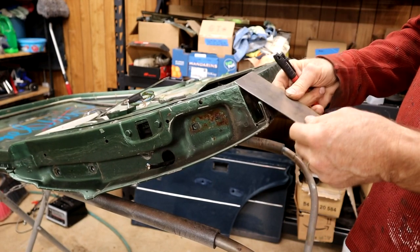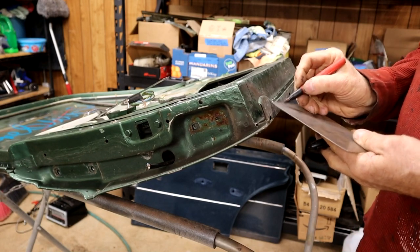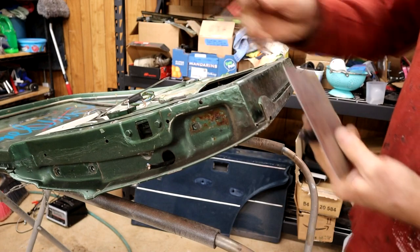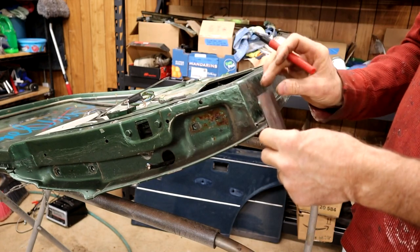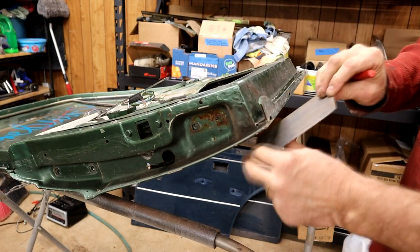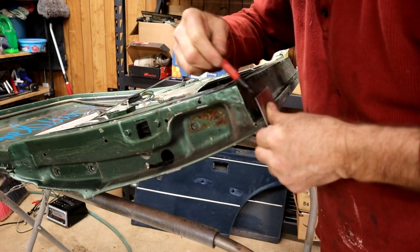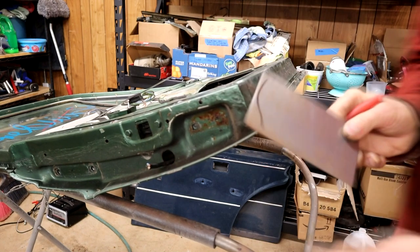So this is going to have a folded lip approximately, if you can see, to fold round under here. And then what we need is this inner shape here. So I'm going to rough it out here, allowing this overlap. So I've got more metal than I need, you see. So always try and get that profile, something like that, if you can see that.